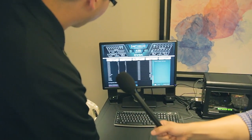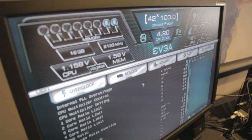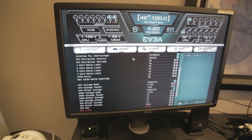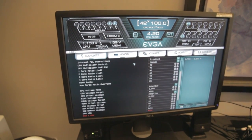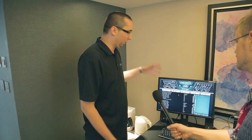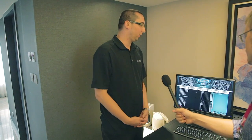You can obviously use the mouse — you can scroll, and scrolling works just as you'd expect. But you don't have to use the mouse; you can use the keyboard just like any traditional BIOS. We found some people still prefer the keyboard, so we didn't want any splash screens they had to click through. We wanted it to be familiar and also new, giving useful information at the top — CPU B-clock, multiplier, CPU frequency, hyper-threading status, and core count.